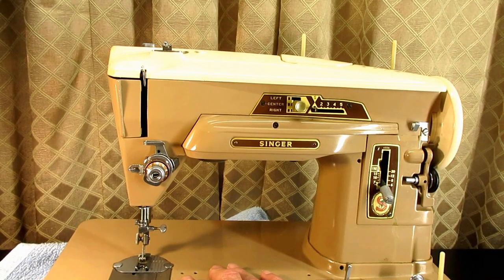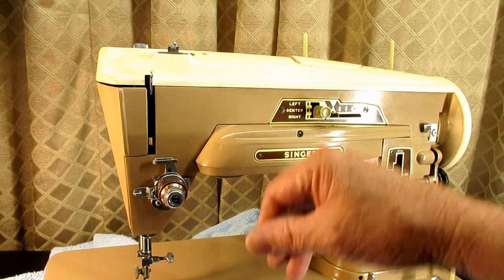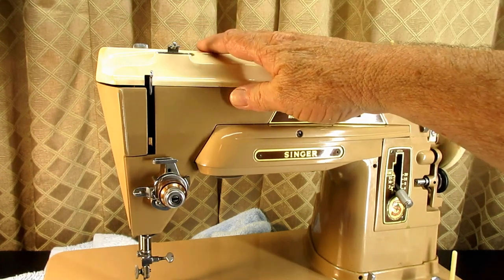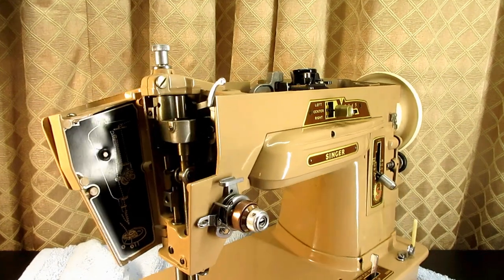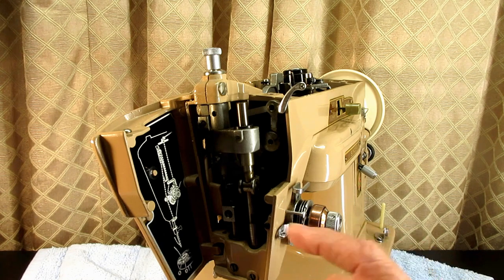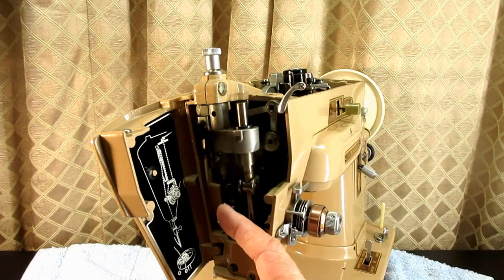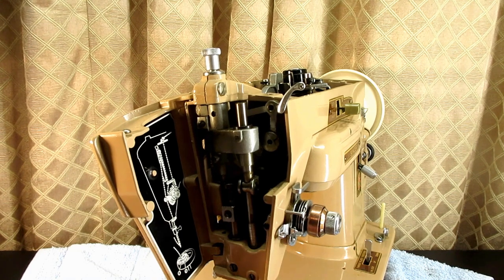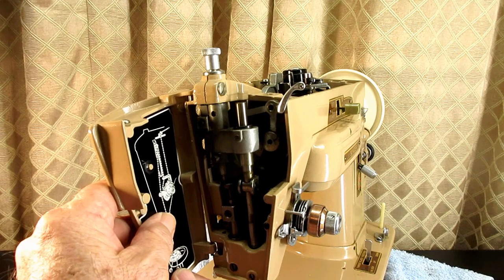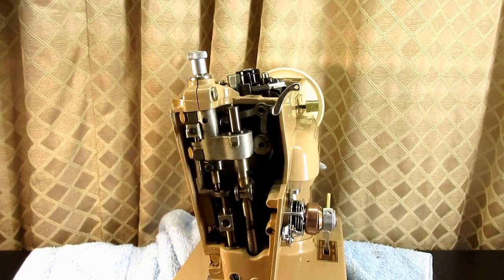Let's get started with checking the height. I'm going to recommend that you remove the arm cover — it's just two screws on the top and it lifts straight up. It's not really necessary, but I like to do that when working on the machine. I'm also going to recommend, though it's not required, that you remove the nose cover. That's basically why I take the arm cover off — because of the weak point of these little hinges, I don't want anything to happen while I'm working on the needle bar. Just lift it up a little bit, tilt out the bottom, lift up the top and remove it. Now we've got a clear shot at the needle bar.